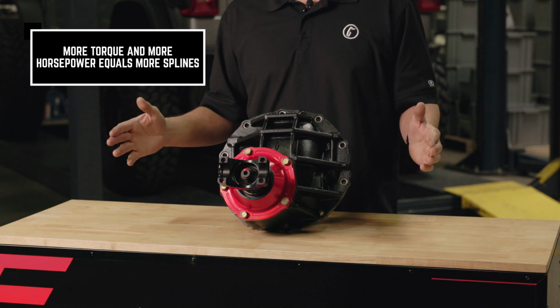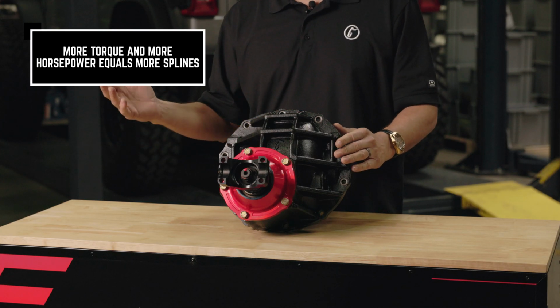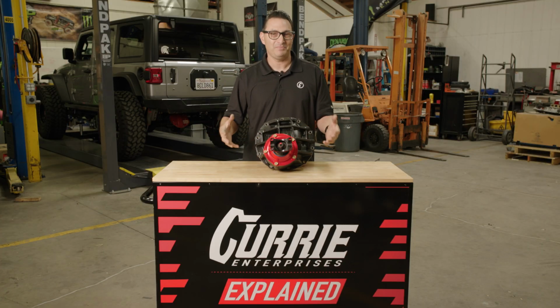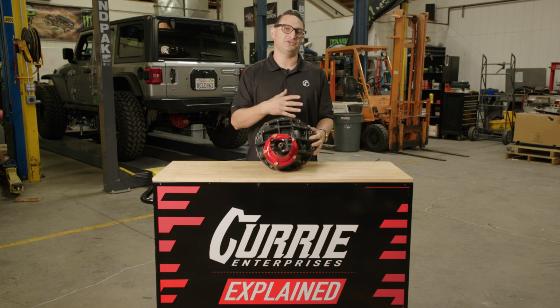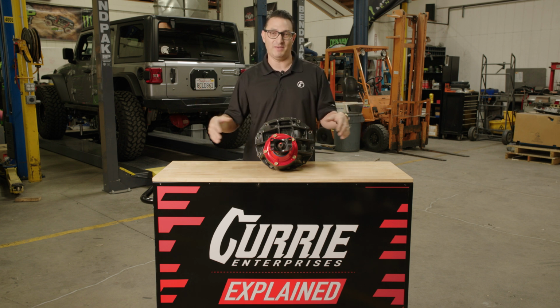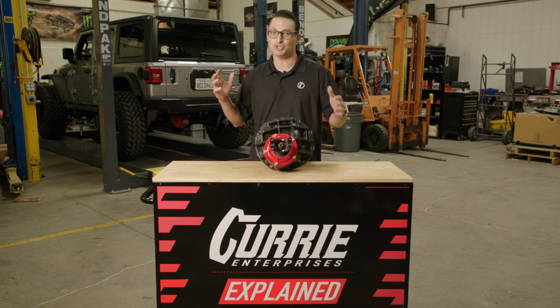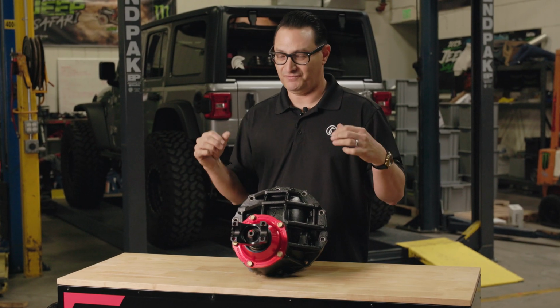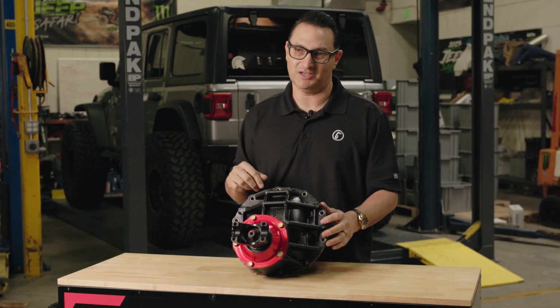So if you're running a wide tire and making 1,000 horsepower and you're launching on a prepped surface on a drag slick, consider moving up to the 35 spline. Or if you're doing heavy racing, autocross, long track, where you're going to have a lot of tire on the ground, making 1,000 horsepower and making traction. Making traction is key. You're not just doing a burnout. If you're making traction, let's go ahead and upgrade to 35 spline.